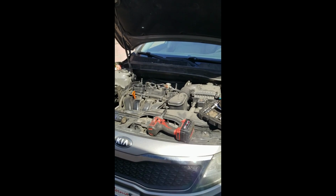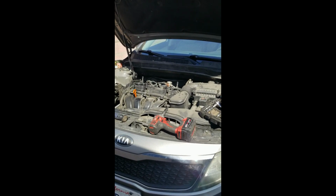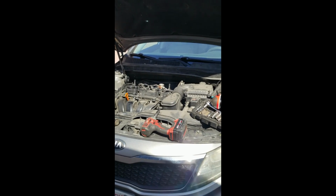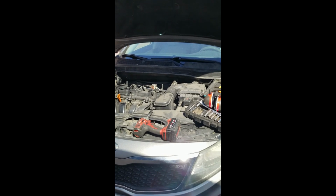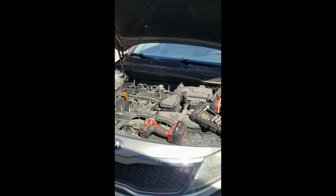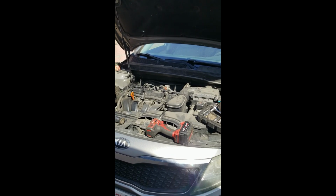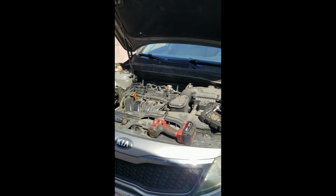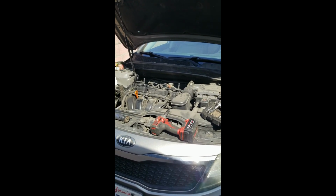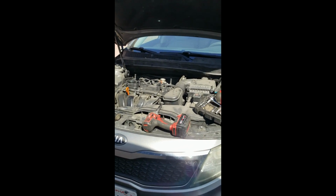So this time, there are only a couple of little things it could be. The battery is not charging. To disprove that theory, we put a jumper box on the battery, and then we tried to start it, and we just got a grunt out of the starter. So we decided this is a starter that has drawn too much current and can't perform its job anymore. The starter was not changed when the engine was put in. It was operating properly at that point.